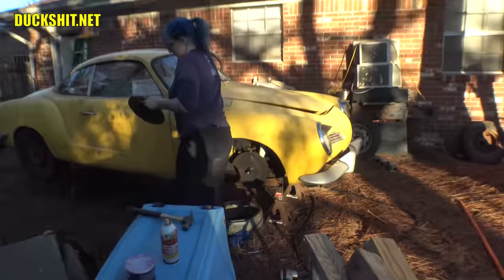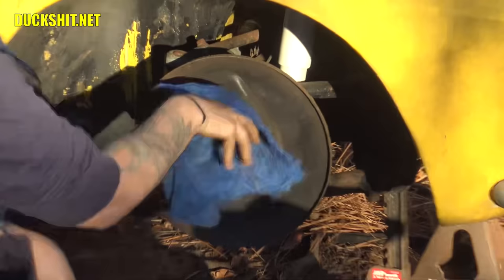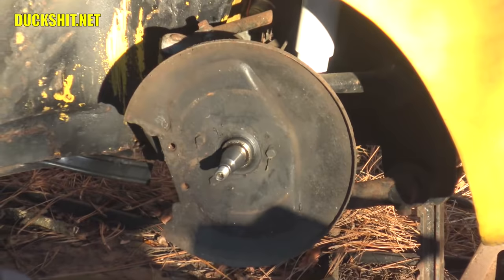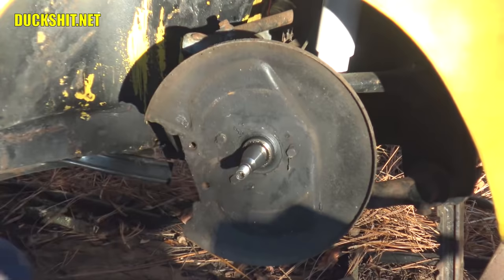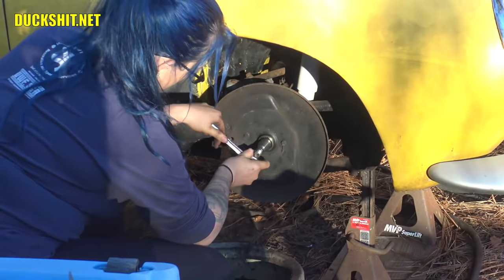That's it. All right, that backing plate that's in there needs to come off now. And I think we determined they were 12 millimeter nuts. I think that was right, maybe 11s. Either way, you had the right tool there for it. They come out pretty easily. Gunky. Yeah, it's gunky, but it's not rusty and it's not smashed up. Which again is another reason that tells me that all these parts had been replaced on it prior to me getting the Ghia.